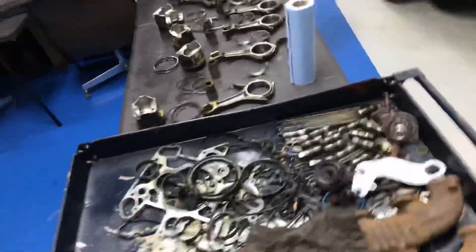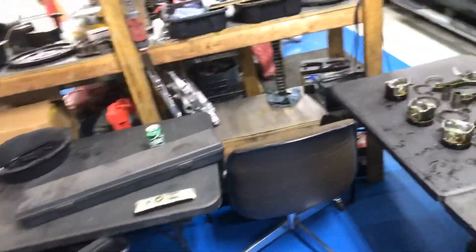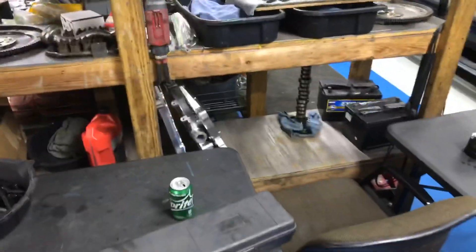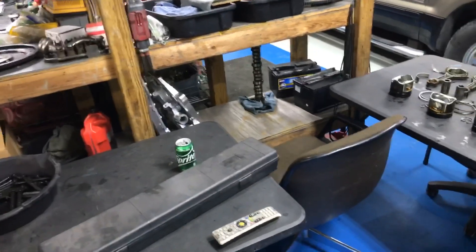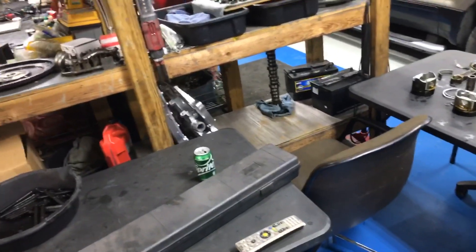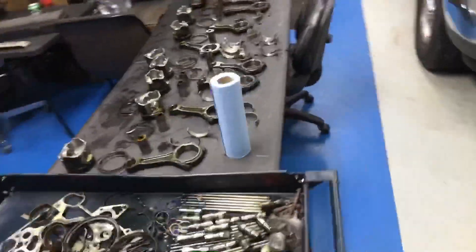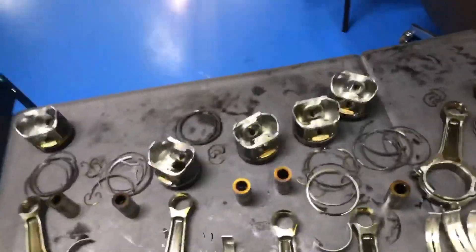I've never actually had a tone ring on a crankshaft come off. The thing that would make it convenient to go ahead and weld it back on is while you're balancing — keep that as an option to pull it off so you can put some mallory in the side if you have to. Sometimes you might just have to, and it'll make life easier. If you take the tone ring off you can put it inside, but it's a pain to drill, whatever.